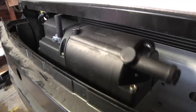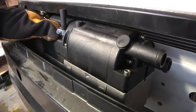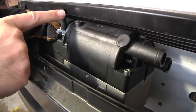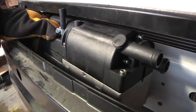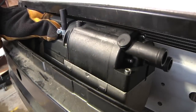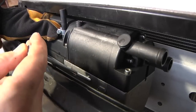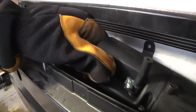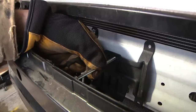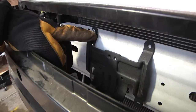With just that one bolt in for testing, I can get the heater in here and get it on that bracket — it goes about like that. I can already see a couple of potential issues. One is this fuel inlet — I might need to put a right-angle adapter on there because it's really close to the top piece of metal. The bigger issue is this hole right here, where a long bolt is supposed to go through the heater to hold it onto the bracket, and with this piece of metal in the way there's no way I can get that through. So it looks like I'll have to put the heater onto the bracket first, put the bolt all the way through, and then install the bracket into position.